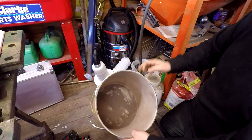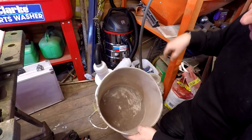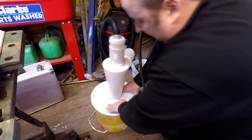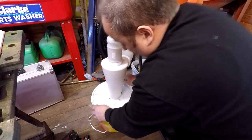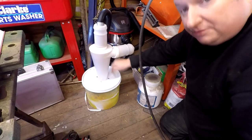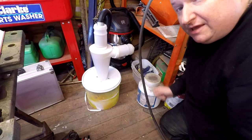So this would have been blocking up the filters in my vacuum cleaner, and it's a big nuisance, because as soon as you get that in the filters, the vacuum cleaner stops working efficiently, it all fogs up inside, and you've got to keep getting the vacuum cleaner out and cleaning the filters, which is a real nuisance. So that is definitely worth doing. If you've got a sandblasting cabinet, like I have, get yourself one of these Cyclone things. I'll leave a link in the description below this video where you can pick them up on Amazon. Get a plastic container and just jiggle it about and make this your sandblasting catchment tray rather than it going into the actual vacuum cleaner itself.